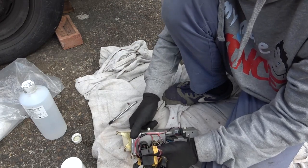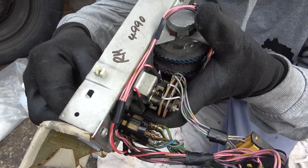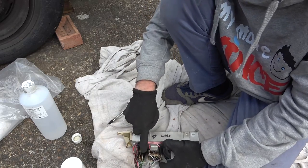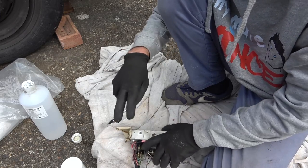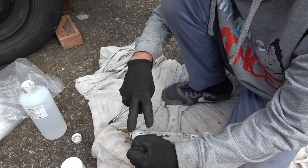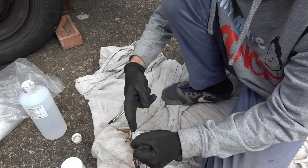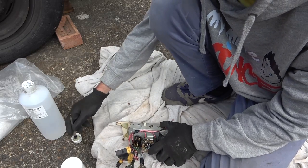Thank you, guys. So I presume what happens here is the middle one, if you look at the middle wire, you can see when I pull the switch on, it does actually come inwards. Yeah, it comes towards here. So what I think is, we have a load of switches. Imagine this is one of the switches, the two that's not working on top, yeah? And then the middle wire, the one that does the in and out, is attached to a big lump of copper. Imagine maybe like a copper penny or something like that. When we pull it, this is the copper penny here, it's shorting these two together. Then when we push it in to turn it off, it does that. So I think that's what's happening. I think all around the edges, there's various switches. And by pulling the switch this way, you're pulling this lump of copper in to short these two together.